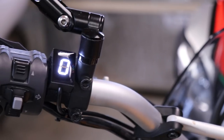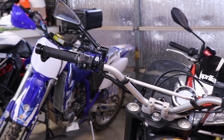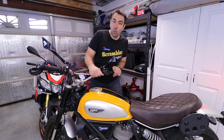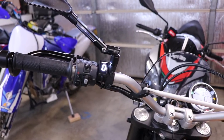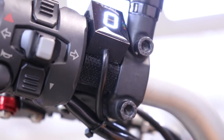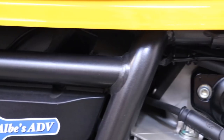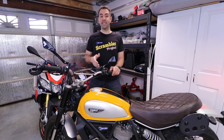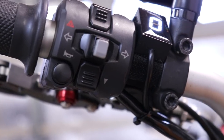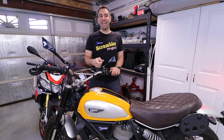We are done for today. The gear shift indicator is in place, it works properly, and it seems quite solid even with just velcro. I took the bike down the street to check it out and it's recognizing all the gears. I'm pretty happy with it — especially because it was cheap, the installation was fairly easy, and the only annoying part was routing the wire all the way back. If you chose to put the wire in the same place I did, remember to use the yellow wire rather than the red one — the red one is for the brake light. For everything I used in this video, check the description below for the link to the gear shift indicator. If you like the video, like it; if you love it, subscribe. Ride on and I'll see you next time.